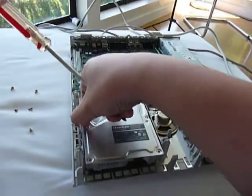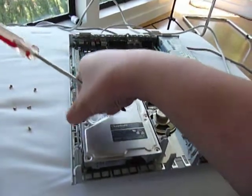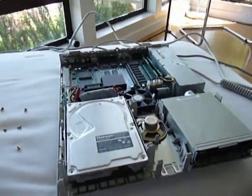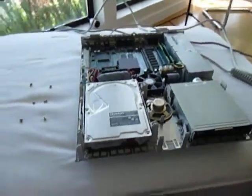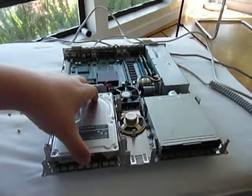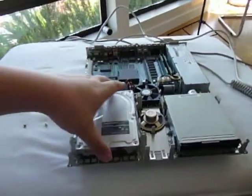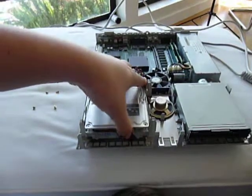This room isn't too dusty, so hopefully I'll be able to get some files off of this, because I do have some floppy drives right there ready to use. This involves turning it on and waiting for the hard drive to spin up to its full speed, and then moving the armature of the drive over. So I'm going to go ahead and open this up and give that a try.